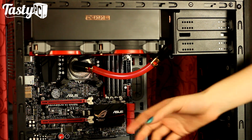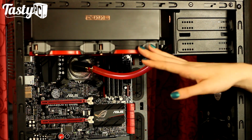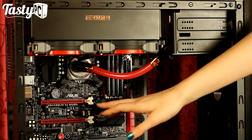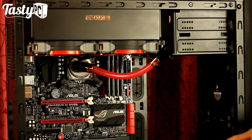Because even if you do end up covering things like the hole in your block, because of the offset fan mounts, you actually have space between your radiator and the block to run things like tubing and fittings. With my little example loop here, I'm using an Alphacool Monster Rad and a Phobya UC2 Plexi block, and I've got roughly 35mm of space to work with, which was enough to fit a Monsoon 1610 90-degree rotary fitting and a straight compression fitting.